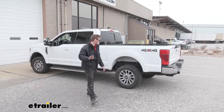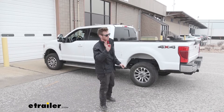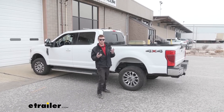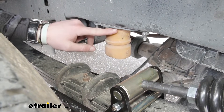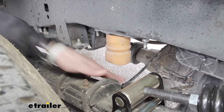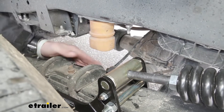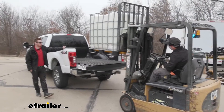With airbags a lot of the time you don't have a whole lot of travel - we're not really limiting our travel here, we're just beefing it up a little bit. With limited travel, when you hit bumps sometimes your back end starts hopping off the road. With this we're not going to have to worry about that because it's just a little tighter suspension, not completely locking it in like airbags. Comparing them to upgraded bump stops - a lot of those we sell are just a little bigger and start hitting the axle sooner, but when the suspension isn't sagging much you're not getting the benefits because bump stops are only activated under load. With this, it's activated right now, so you don't have to wait to get to that point for your upgrade to start kicking in.